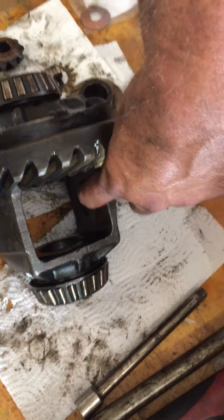I would probably say from my first video, when we took the rear cover off and drained the fluid, all that sludge that was still dripping and oozing out of the differential housing is one of the culprits. Either this differential started making some noise at one time and someone put sawdust in it to quiet it up, and in the meantime it just destroyed a lot of parts.